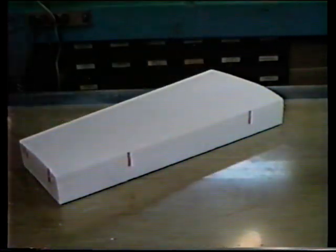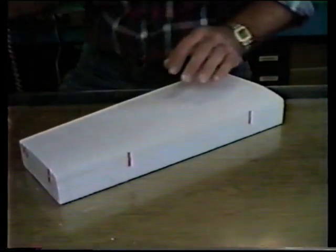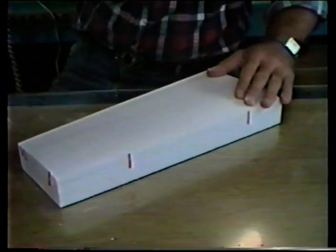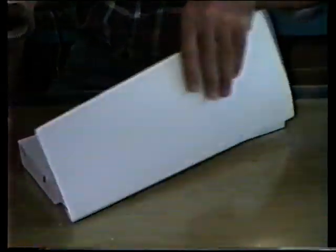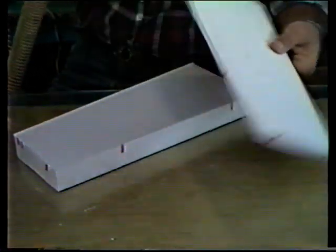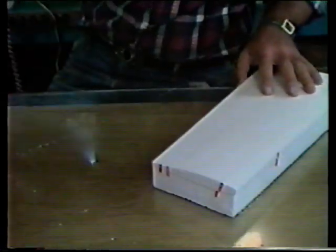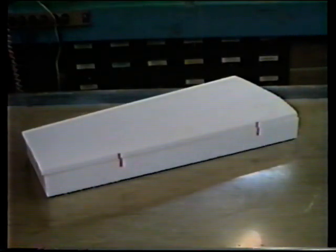In fact, let's see how much stuff comes off of this. This is my shop vac on a long hose. This will get some of it off. But most of it comes off with compressed air. And if you don't use the compressed air, you really run the risk of, yeah, a lot of the junk just comes right up when you do this. And I like to keep them in the cores all the while, because obviously these are delicate parts at this point in time. Easy to hurt the core.